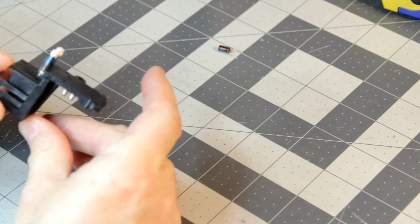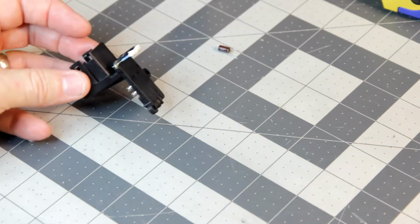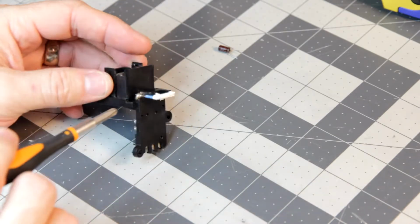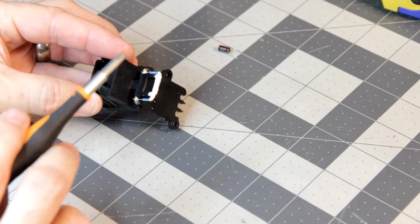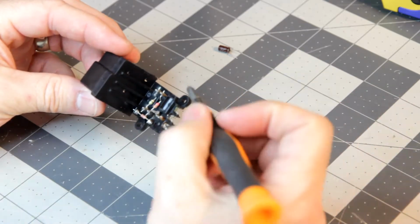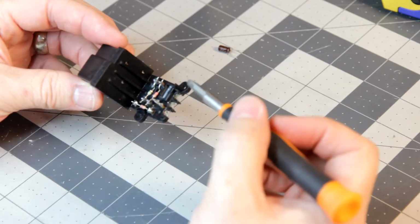So now, since I know the transistor is good and the capacitor is testing out, at this point I'm going to have to check the thermal fuse. What I'll do with that, it's covered in the stuff, the thermal paste. I'm going to probably desolder it to test it out of circuit and then see what it comes back with. It could have just been that this thing overheated, and that's the only component that's gone bad. After that, I may pull some of these leads and test these resistors to see, because there isn't much else.